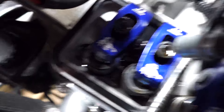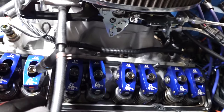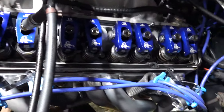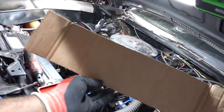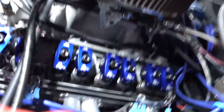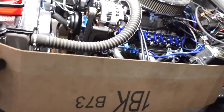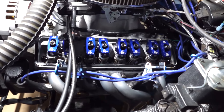On initial inspection — I don't have my flashlight right now — you can tell that all of the rocker arms are oiling like they're supposed to. Everything looks good from that standpoint. What I'm going to do is put some cardboard in here to keep the oil from deflecting everywhere, and I'll start it up and let it run so you guys can see what's going on. I'll cut a piece of cardboard about 17 to 17.5 inches to lay across the cylinder head.